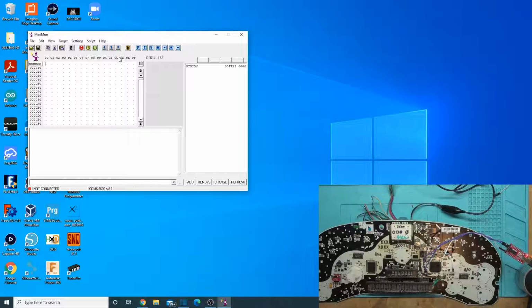But let's take a look at what happens when you try to program one of these semi-defective boards. I don't know if it's the oscillator, the voltage regulator, or what the deal is, because it does seem to have some voltage issues. Sometimes this would come on and you could see it flicker while it was trying to program. Maybe it's not necessarily a voltage issue, but a current issue where the regulator is just not getting enough current to keep up. Not 100% sure, but let's go ahead and give it a test.